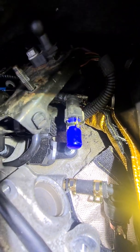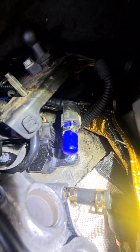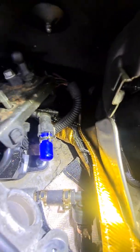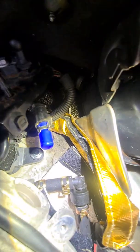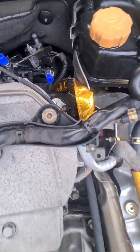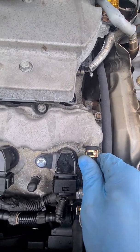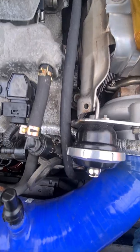I've got AN6 rubber hose and a 10mm brass straight push-fit union. I pushed a piece of AN6 hose inside the rocker cover then pushed in the brass union — it's much tighter than the original plastic fitting which had broken anyway. These ideally need a one-way valve, so I reused one-way valves from a couple of old scrap engines. That pipe now runs along where the SAI system was, and I've done the same with the front rocker — a piece of pipe and a union inside. Both will be sleeved together with anti-chafe sleeve material.